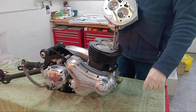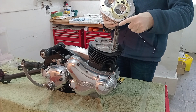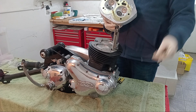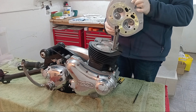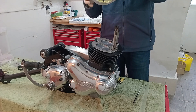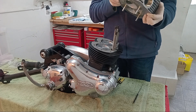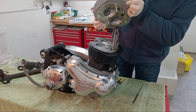We'll lower it down and see — the tricky part is going to be engaging the push rods with the rockers. I've got a little magnet since the top of the push rods are steel, so I can use a magnet and a screwdriver to prod things around and try to get them in the right place. Once they're engaged it should be plain sailing — famous last words. It's getting those push rods engaged that's the real challenge.